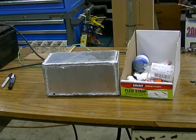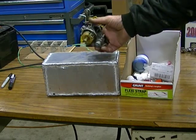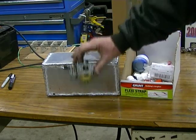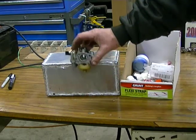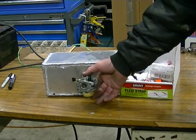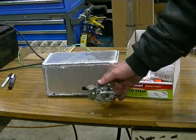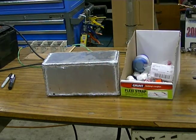I'll strip the bowl and that off a carby, and this carby is going to be bolted on the inside down near the bottom — that's going to act as our fuel level meter. We need this one to keep the fuel level in the vaporiser at a constant, and we still want to be able to use our 100mm fuel gauge.